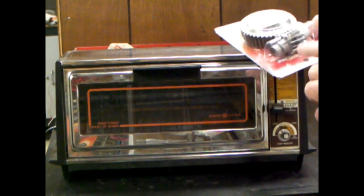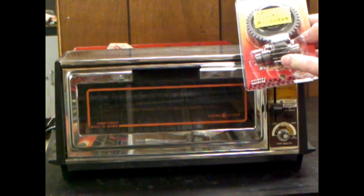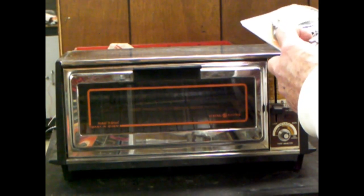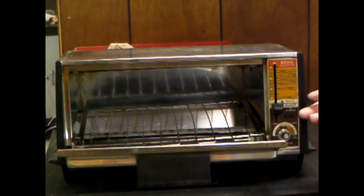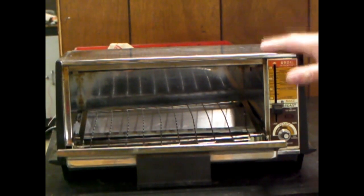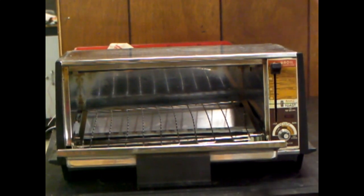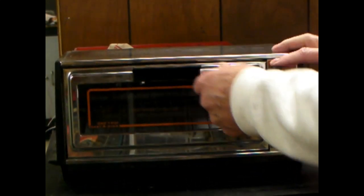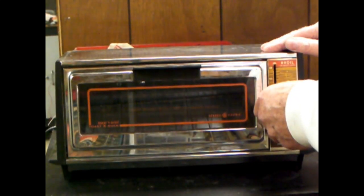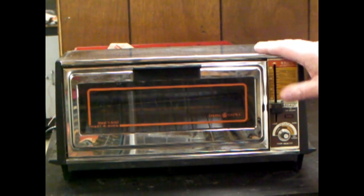In order to put these together, I put this pinion gear in the freezer to get it cold, and the other gear I put in the toaster oven. This is just an old toaster oven I keep around the shop for heating things and doing jobs like this. Slide it up to broil — that's as hot as it'll go. You can't really hurt the gear with one of these things, as long as you don't change the color of it. If you're using a torch, don't heat it more than straw-colored or you might ruin the heat treat.